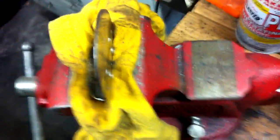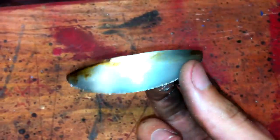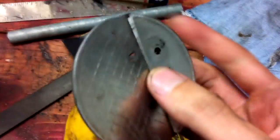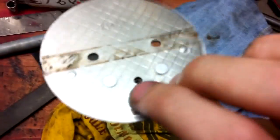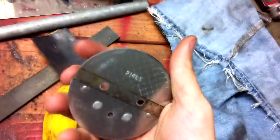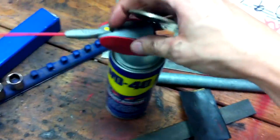Here's how I set it in the vise — just like that. Once that's done, clean it up and slam it back in the truck. After filing off the burr I angled it so there won't be any drag, and I cleaned it off real well. Make sure that the small hole is not clogged — you need that for your idle. Made sure there are no aluminum shavings, and always remember to use WD-40 when working with aluminum.